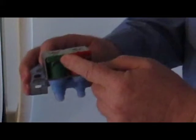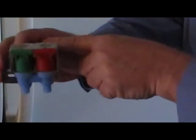If you need ice, water will come out of here and go to fill the ice maker, but we're more interested in where the cold water comes from. When you push the lever, you trip a switch which sends 120 volts down to this solenoid right here, opens up, and water from your house comes in through here, comes out here, and goes down through a filter — but still we haven't answered the question: how does it get cold?